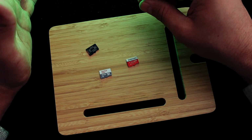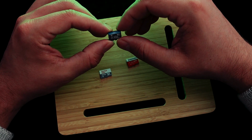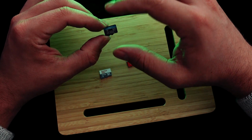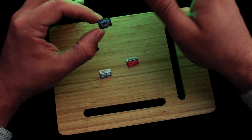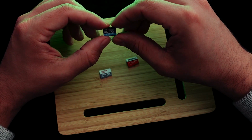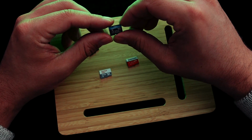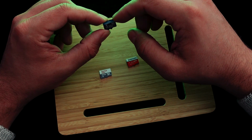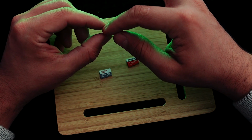it's cheating, because some manufacturers in China do one interesting thing. They take 64 gigabyte cards, or even 32 or 16, it doesn't matter. They write 1 terabyte or 2 terabytes, or however many terabytes you want to buy, and they put a special program, firmware, on it. So when you put that card in your PC or mobile phone or somewhere else, it thinks that it's really 1 terabyte of space, and it will show you 1 terabyte of free space. But when you copy some files to it, it will work like dashcam cards. It will copy on one side and erase on the other side.